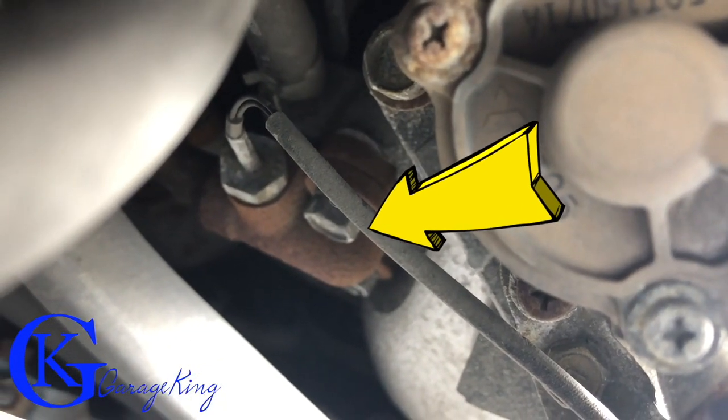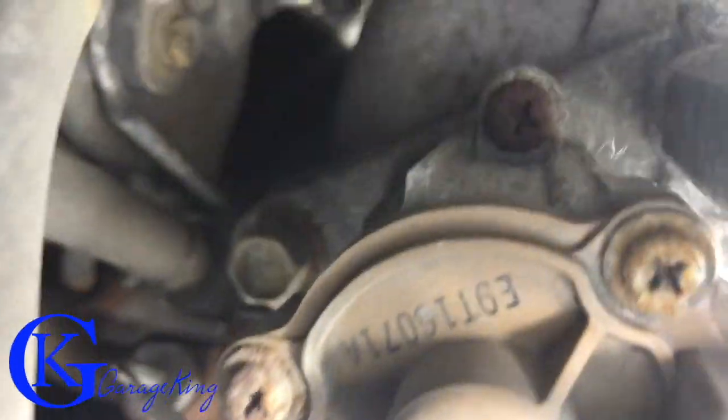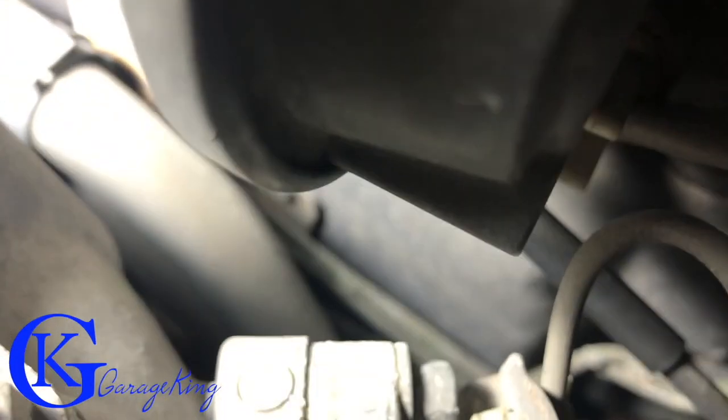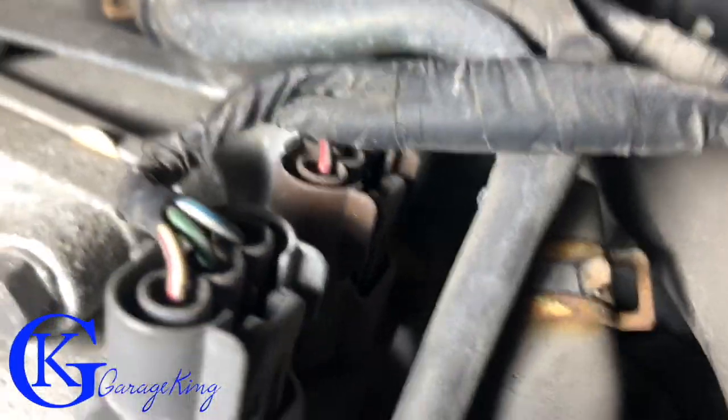There's the top part of the tube right at the very back. We can just leave the sensor in and plug it. You can see there are two bolts there and then it goes all the way down just underneath to the EGR. I'm coming around the throttle body — it's very difficult with this lighting. Anyway, you've got to reach in, see it, then follow the tube down with your hands and you'll be able to get it out.